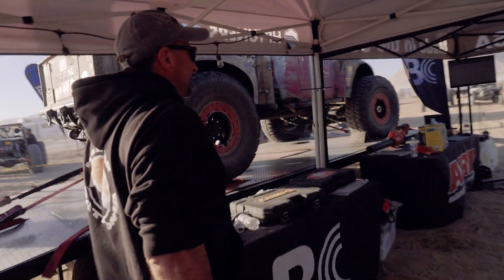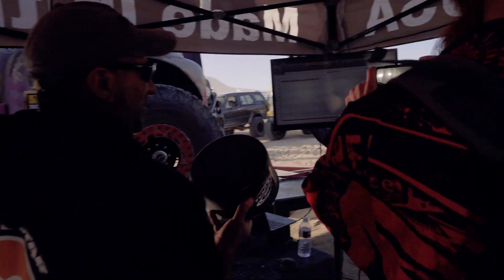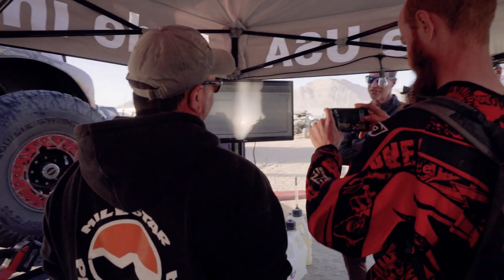170 horsepower — wow, this is an 11 horsepower restrictor right here. It's really good at keeping the air cleaner clean. Those 170 horses with the Donaldson off — it's a total restrictor plate in a sense, but it does help on the long week of Ultimate Adventure keeping your air cleaner clean. I've yet to actually clean my air filter after UA 2022, that's how well it works. But it does cost me 11 horsepower to have it.